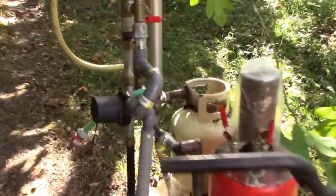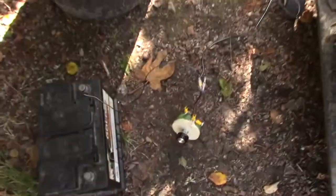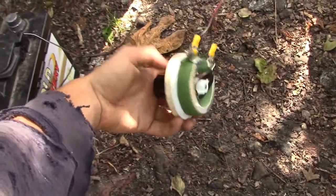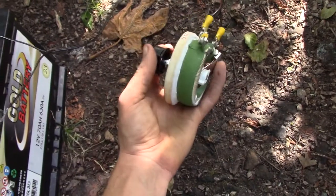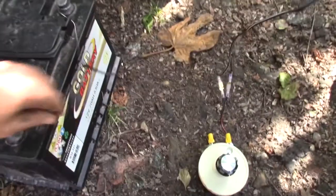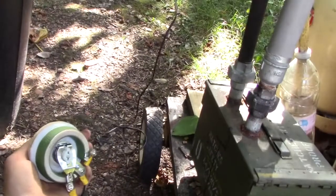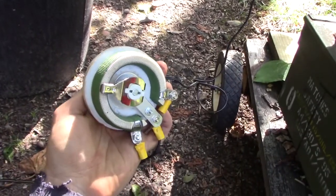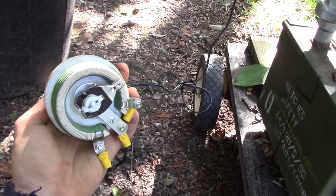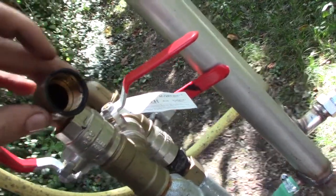I have a new fan — this is a mattress inflating device. I've put a variable resistance on it: a 30-ohm, 100-watt resistor. This is 30 ohms and the fan still runs, but there is very little air coming out.